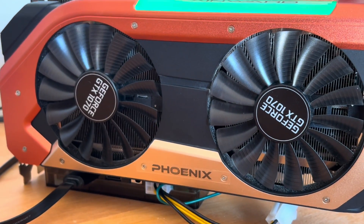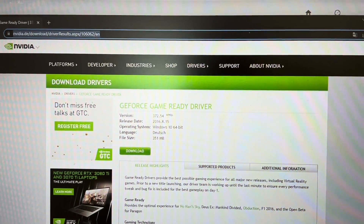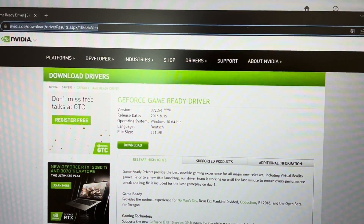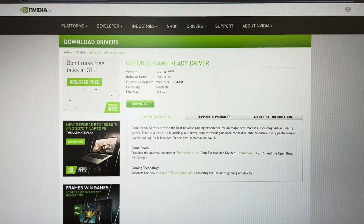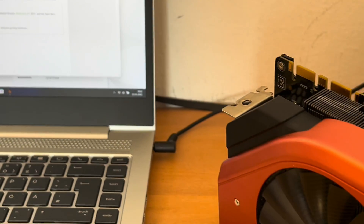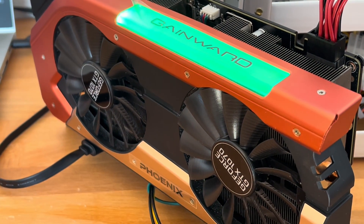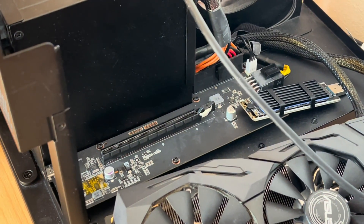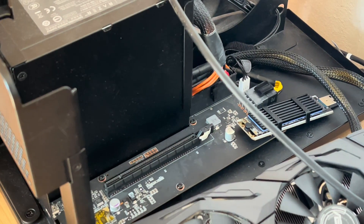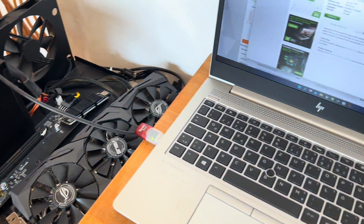As I'm testing it in this example, it only works with a very outdated NVIDIA driver — version 372.54 from 2016 — and newer drivers unfortunately do not work, which is a significant disadvantage. Another disadvantage is that everything is only connected to one PCI Express lane, because the M.2 interface only has two lanes on the motherboard and the GDC module itself only supports one lane. The USB-C variant with a Thunderbolt cable gives you two or four PCI Express lanes, but it also depends on the graphics card.